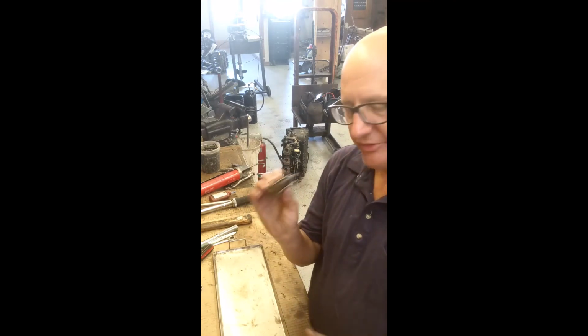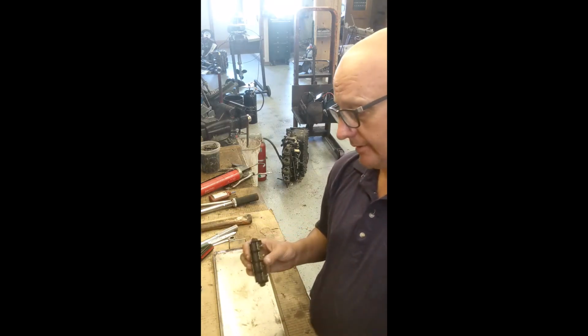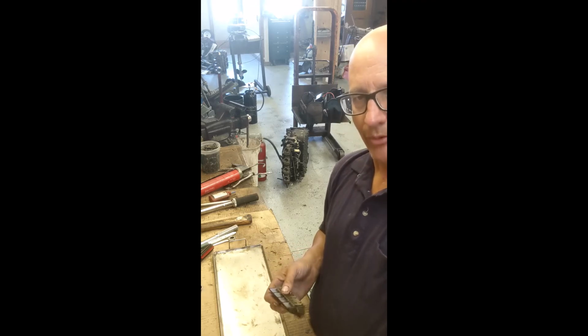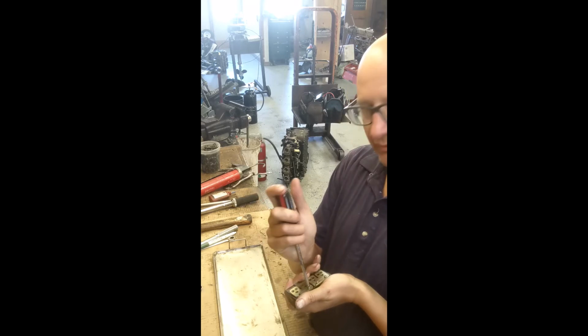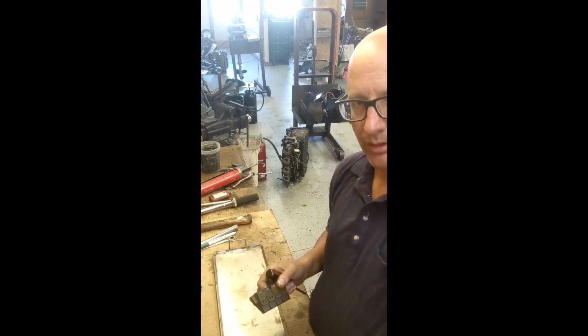So I'll reset the reeds. Even though it's time consuming, you're in there. If you had to fix a reed after you put it all together, it'd take you an extra 2 hours, or less possibly, but might as well build the motor with confidence. And again, recheck all these screws. If one of these screws comes loose, it goes in the engine. That's all she wrote.